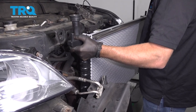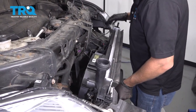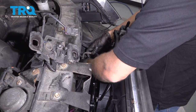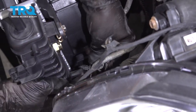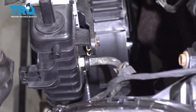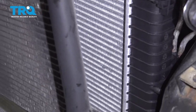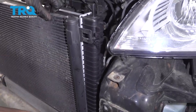Very carefully slide this into position. While it's still out a little bit, you can put the transmission cooler lines in, get those attached, and just lock it in place. Put that cap on, and we have this hold-down — try to get that in place and then lock it down. Get the bottom feet up and put those bushings on both sides. Now we can slide the condenser into position, lift it up a little bit, and slide this in right here.